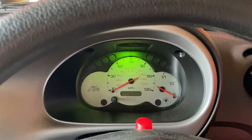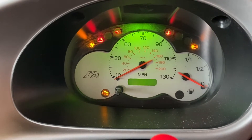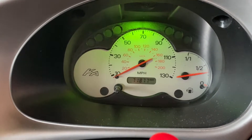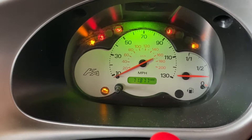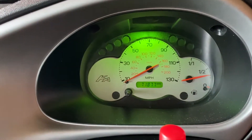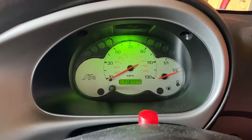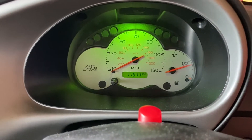Right, so we're in the car now. I'm just going to start the car after replacing the fuel filter. What I would recommend you do: turn the ignition on and let the fuel pump prime. Do that a good three times. If it's quiet enough, you'll hear the fuel pump. I think that was six times, not three. So we'll give it a try and see whether it starts up. There it is, it's running.